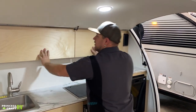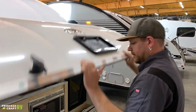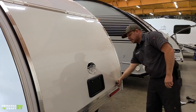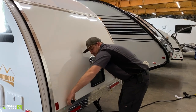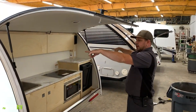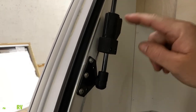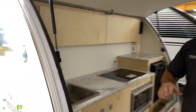When you get ready to close your clamshell, make sure these are closed since they sit right up against it — you don't want to cause any damage. Don't forget to turn your light off. Once closed, the turn latches on the back need a little push because you have seals that need to make a good seal, then just turn them to latch. They're also keyed locked. To open, make sure they're unlocked, turn them so they're both facing up, and give it a little pull — gas struts will take over and lift it up for you. Note the small electric-looking valve on the off-door side strut — this is an electronic gas shutoff for the cooktop; don't break it, it's a safety device.